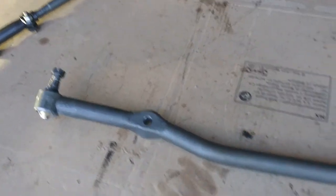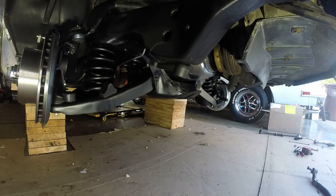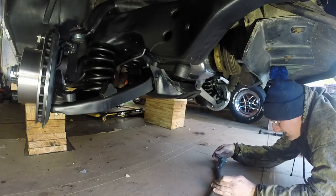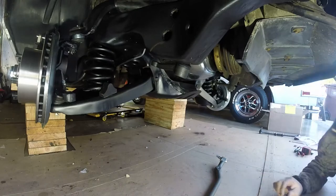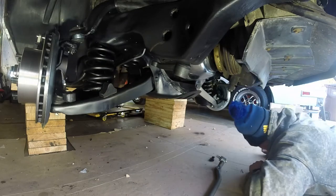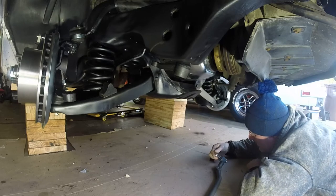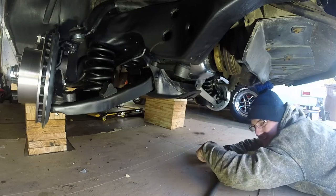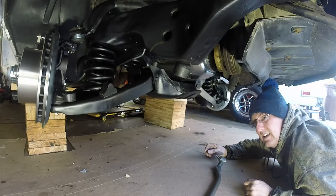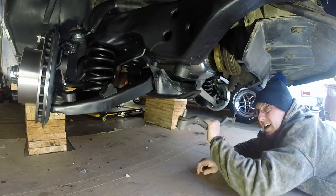We're going to go ahead and attach the center link to the idler arm. Okay, getting ready here to set the center link. I'm putting the grease fittings back in the bag here. I'm going to put those on as the parts are wrapping up the installation. So, got the cotter pins handy. I am taking off the center link castle nuts. Okay, got the castle nuts. Got these spacers handy. So I'm going to put the spacer on and the castle nut onto the side I'm not currently doing, and just barely put that on there. And then this side, put that washer on there, and then we're going to attach it up here to the idler arm.